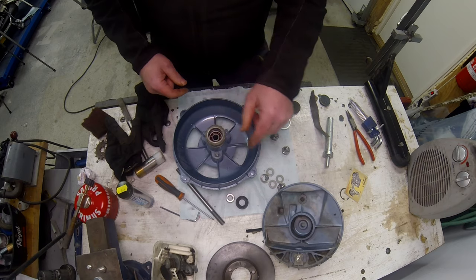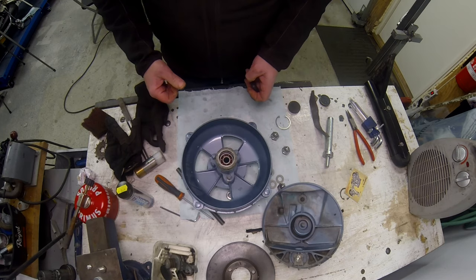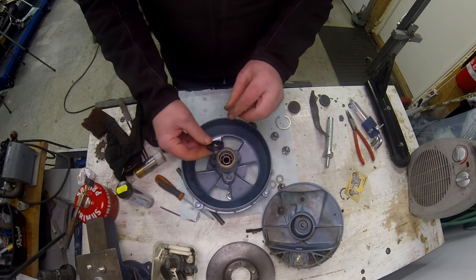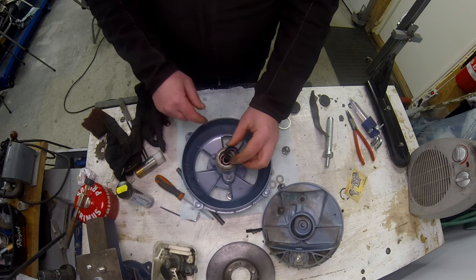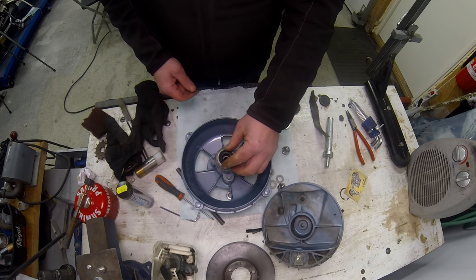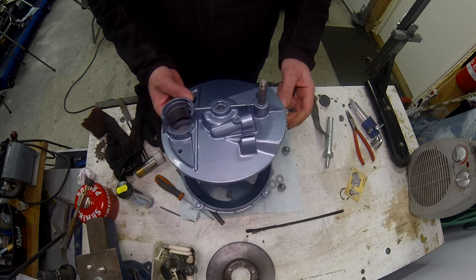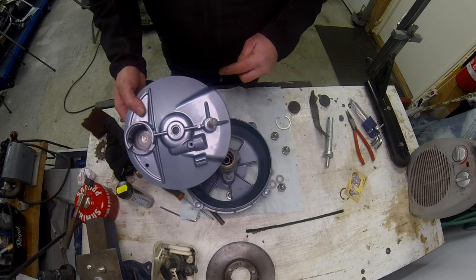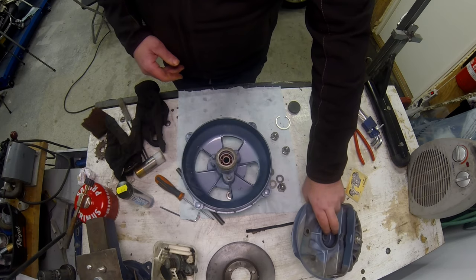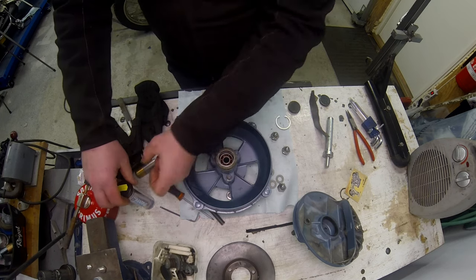I need to fit the seal here. I've been looking online and as far as I can gather from photos and diagrams, the seal has to go on with the springy side facing the speedo drive. I'm not sure exactly why - perhaps if you overfill the wheel bearings you'd also be lubricating that area, though you do have a speedo drive lubrication bleed nipple in there. Looking at Stickies' book as well it looks like it's fitted that way, so I'll go with that.